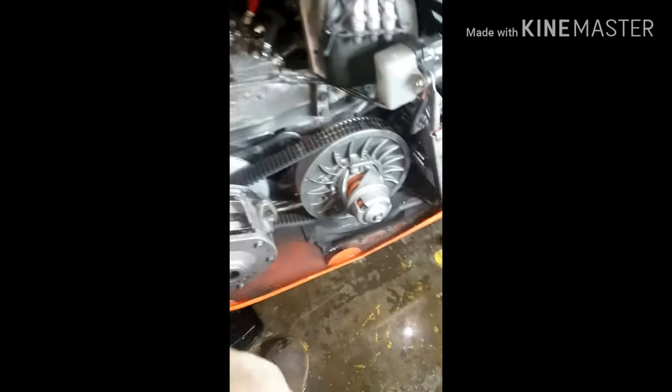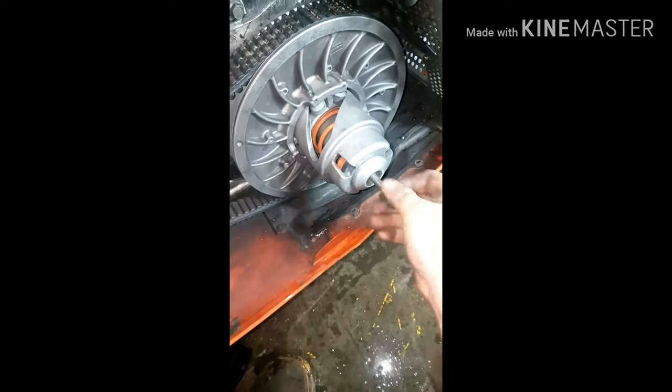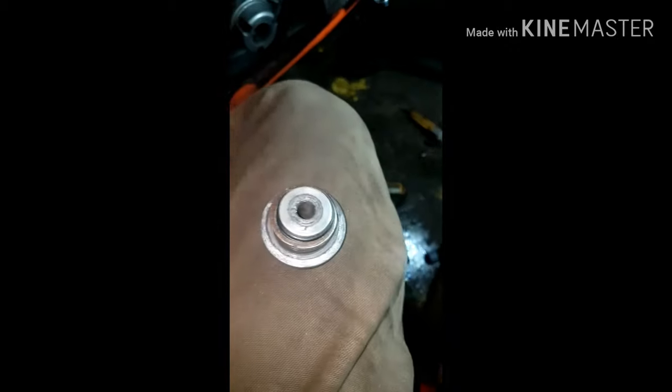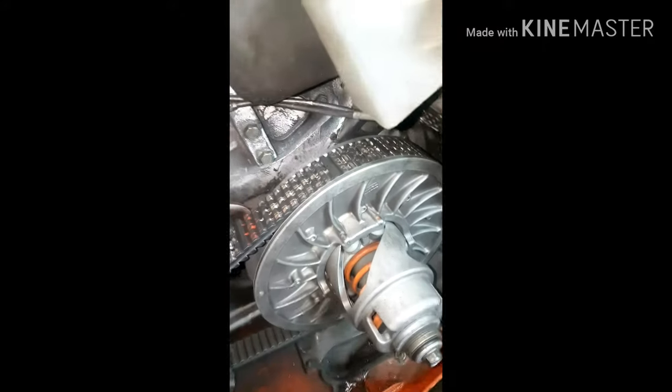So what I'm going to do here — you want to pull this bolt, grab this bolt, take these washers off. What you want to do with this is just flip it upside down, completely backwards. Put your bolt like this, thread your bolt in, and what this is going to do is open up your clutch so you're able to get the bolt off. So tighten this up — there you go. Got the bolt off.